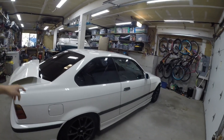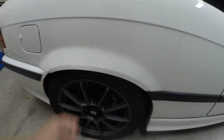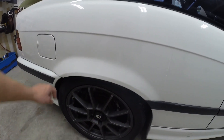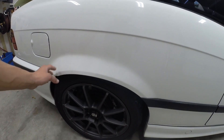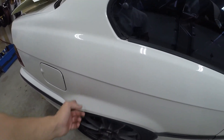We're gonna start on the gas tank side because that is the hardest side - you have to make the gas tank line up so it opens. The first thing you want to do is find where you want to cut. Once you find where you want to cut, there's actually two layers in here. So you're gonna go ahead, make one cut, take that piece out, and then make another cut or figure out where it is behind it. You actually want to leave more metal behind because you want to bend it up so that you can weld the tabs that you cut to this piece.